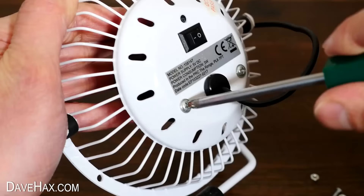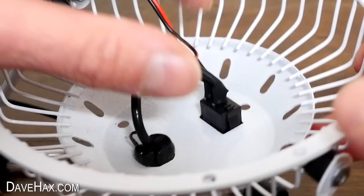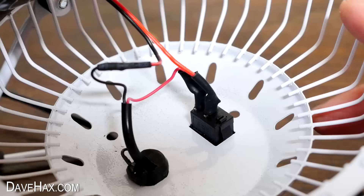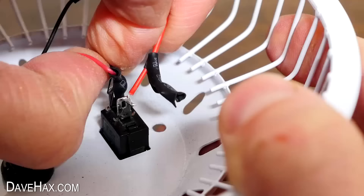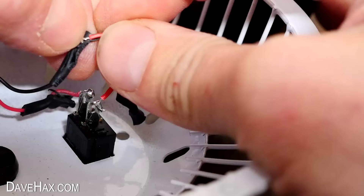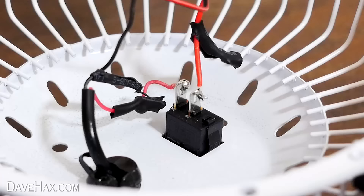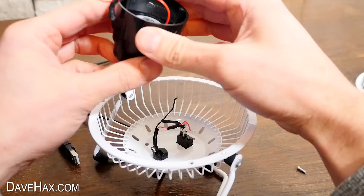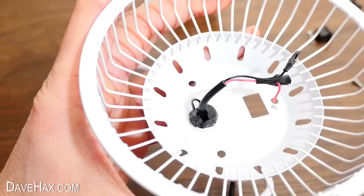When I lifted it away from the back plate, you can see the wires from the power lead and the switch. I was hoping I'd be able to unplug these items so I could easily remove the motor from the fan's casing, but unfortunately the wires are soldered on. So I cut off the heat shrink to reveal the solder joints, then used my iron to disconnect the components. The motor is now free — I can remove the switch from the back plate and push through the power lead too.